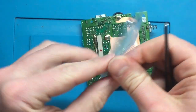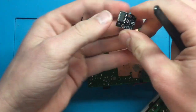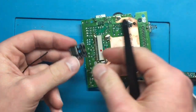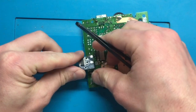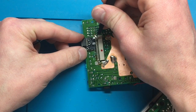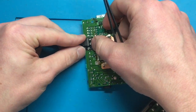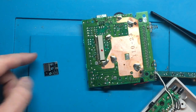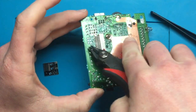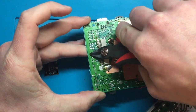We're going to do the bivert mod right now. This is not overly complex but it can be a little more difficult than the previous mod because it involves lifting up some pins from this display connector. This is the chip itself and it's designed to fit right on top of the board here - I think it goes on the sixth and seventh pins: one, two, three, four, five, six, seven, just like that. What you do have to do is a little bit of trimming on the board, so I'm going to grab my flush cutters and cut off as much pin as possible here.